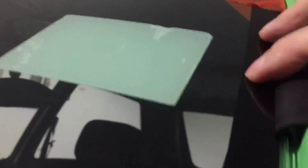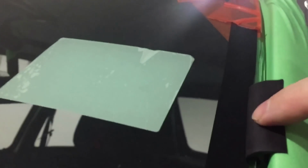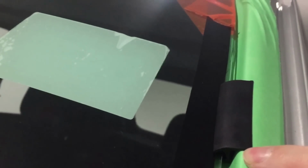So, this is pretty much down against the glass. There'll be lots of urethane. I don't need to push it in and flatten it hard against the metal. I can let it sit on the urethane and sit up a little bit proud, but I'm still going to have this drop from the metal into the glass. And I'm using a 17 millimeter generic, or is this one 17? Yeah, this one's 17. I've got 17 and 19. This will provide a little bit of an overlap. It's the right look in terms of the original look, in terms of width.